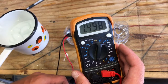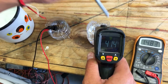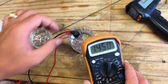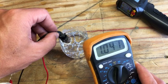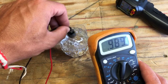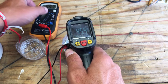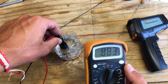The next water is warmer again, about 40 degrees Celsius. For 40°C we should drop to 1000 to 1500 ohms. Checking the thermometer more carefully, it's actually 45 to 46 degrees Celsius, so the correct range is 750 to 1250 ohms. Ours is reading about 850 ohms — close, so that's good.